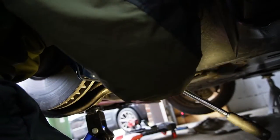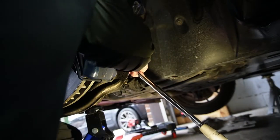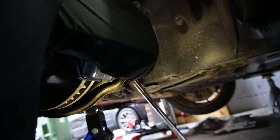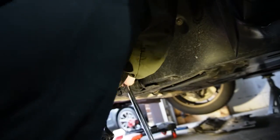Next, let's remove the fill plug. I was using a combination of extensions and trying out different sizes of breaker bars to aid in removing it. It's rather tight from the factory and didn't feel like it was 60Nm at all — it had to be over that for some reason. I'll share the combinations I used after I've torqued the fill plug back down, so stay tuned.